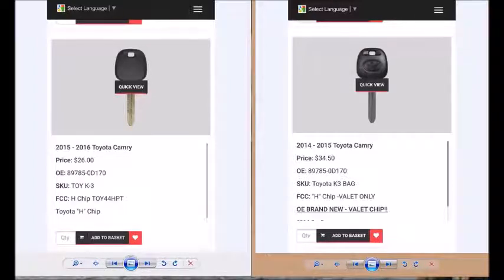It's really important to have a distinct understanding of how the manufacturer designed their system, because there are rules that they put into place. For example, on Toyota Lexus, whenever you reset an immobilizer, the first key that it sees has to be the master key.